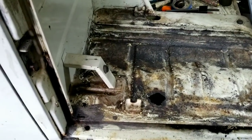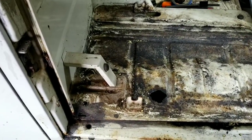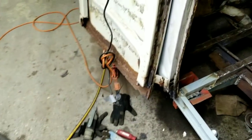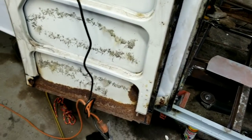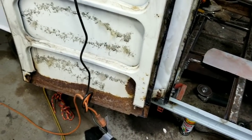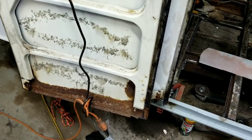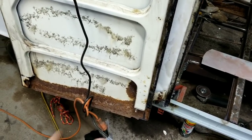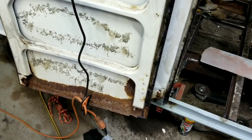When you can thin that stuff down it can get underneath better, and that's what I do. A lot of guys say 'I do mine all at the seam so everything's right, I paint it behind.' But as soon as you hit the welder on there, guess what — it opens it up again no matter how you do it. I think there's no foolproof way to do it; it's just doing the best you can to try to keep the car from rusting again.